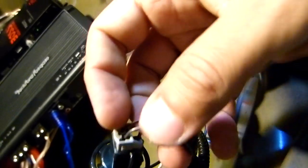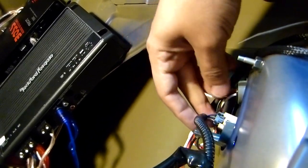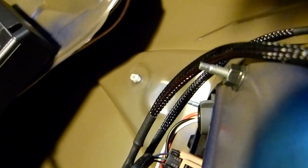This is not that hard, all right? So just remember, connected to the turn signal is the gray, and for the brake lights is the blue on this side, and if you want to connect the blue light, you can connect it to the green in here, okay? The reverse, you have to put it on these lights, but I don't know if you want to run it all the way over there. But you already saw how it looks, it's very bright.